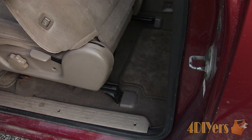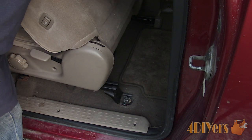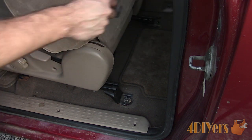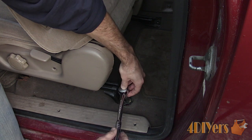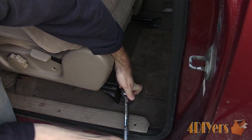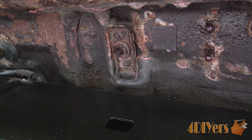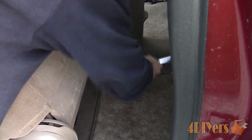Next, moving on to the driver's side. Again, move the seat forward and start with the rear bolts first. Remove those plastic caps using a pry tool. Using a 1/2 inch drive ratchet with the 14mm socket, remove the bolts. I did apply penetrating oil to help remove the bolt — it's directly accessible under the floor of the truck. Remove the other bolt by the center console.